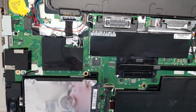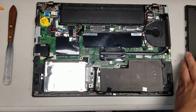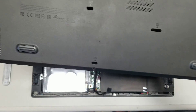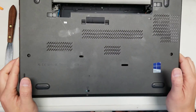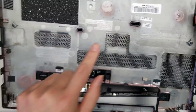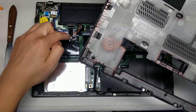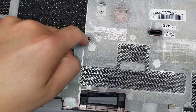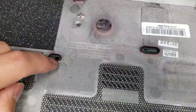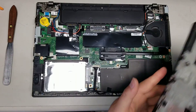These models have little holes so that if you spill something in the keyboard, liquid drains through. Importantly, don't flip the laptop upside down if you spill — if you flip it, liquid can go under the cover. If you leave it upright, it drains straight through the holes. The lip is raised to keep water going straight down.